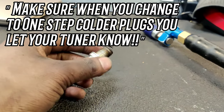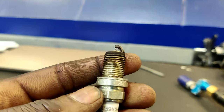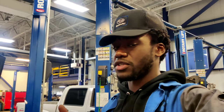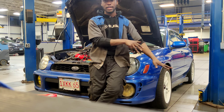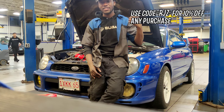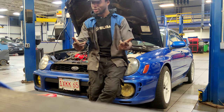I'm also doing the one-step-colder spark plugs — the old ones are just stock heat iridium plugs. This one looks a little wet, from cylinder 4 where the water got inside, but I blasted all that water out, made it completely dry, and took all the spark plugs out — I didn't see anything coming out so I think we're good. Also, shoutout to the sponsors — Wickedly Boosted. I'll leave a link to their Instagram and website in the description. Use code RJZ or the link below for 10% off everything.